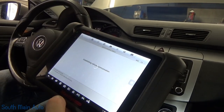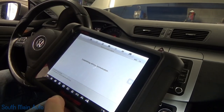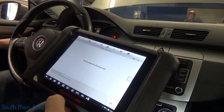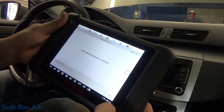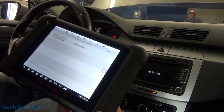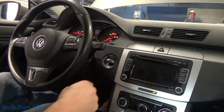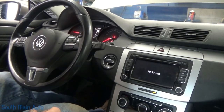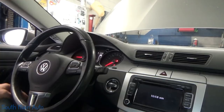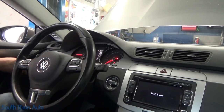Battery voltage is getting pretty low. You can hear it back there making some noise — it's gonna go through a little process. Parking brake light is flashing. Apply the parking brake. Brake pad replacement complete. I'm gonna turn the parking brake back off — I think you've got to hold your foot on the brake. I'll pump up the brakes. They feel good. Hopefully the car battery is not too dead. The brake pedal feels nice. Now we'll take her for a little toot around town to see how it feels. Make sure the parking brake works — we'll roll backwards, hit the button. She grabs and releases.